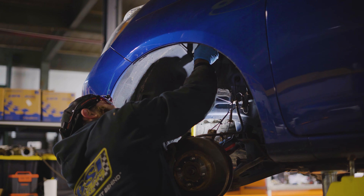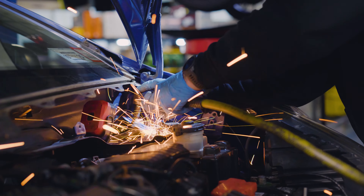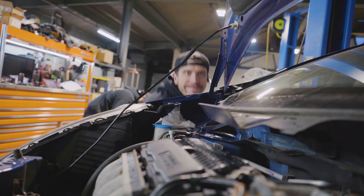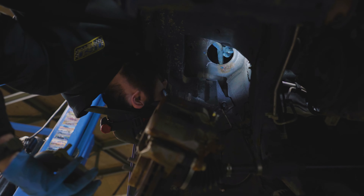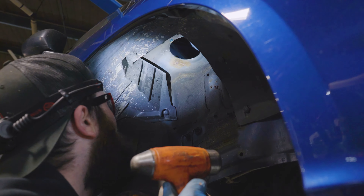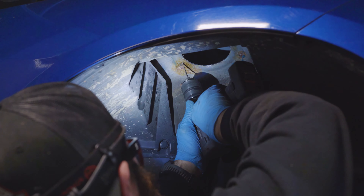Some people are afraid to make the cuts, but one of the large reasons I originally made this design was to spread that load out — at a 10K spring in the front I was popping spot welds. So then what you can do — right now he's using one of our old design plates to mark the positions. He put some grease on the bolt heads and is marking those positions, then putting a center punch there to start his drill. He'll go in with a small drill bit and step up to larger sizes to reach the final hole size.